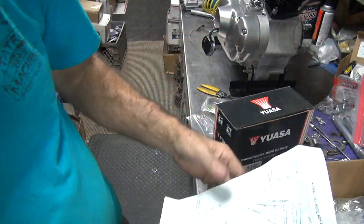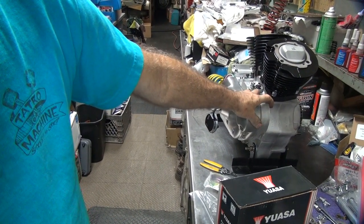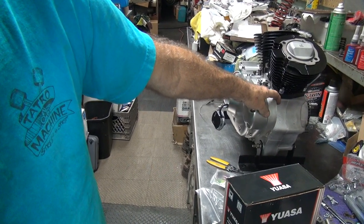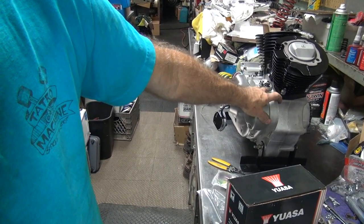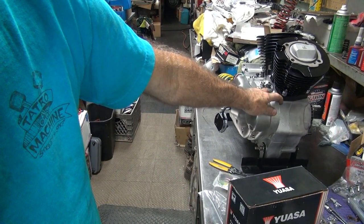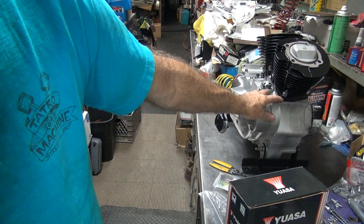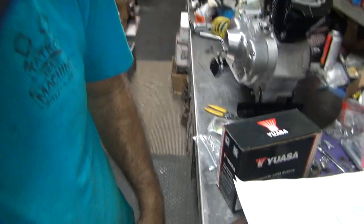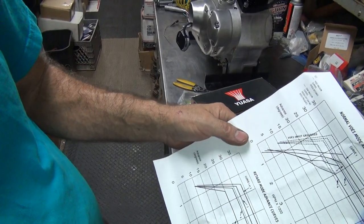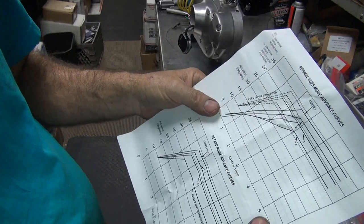Now Sportster motors, the 1000cc motors, are 39 degree timing, which started on the 73 flywheels, so the 72s had the early stuff on them. The early flywheels, the dash 57 flywheel, run 45 degree ignition timing. So if you take the 1000cc motor and put it up to 45 degrees, it runs a lot better. They changed it because of gasoline. They run better at 45 degrees. And you can always kick it back more and get 49 to 50 degrees, making them run better, like having a high compression motor.